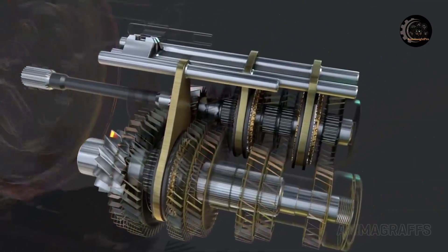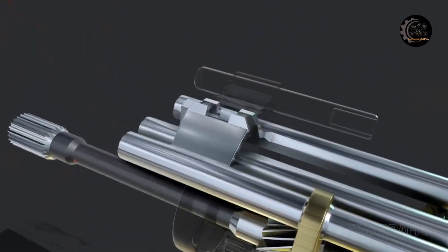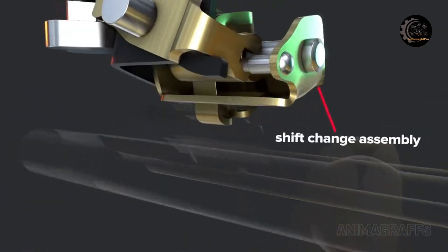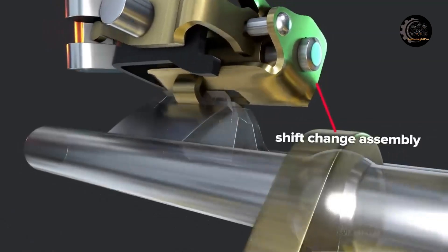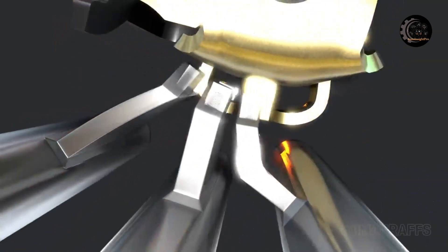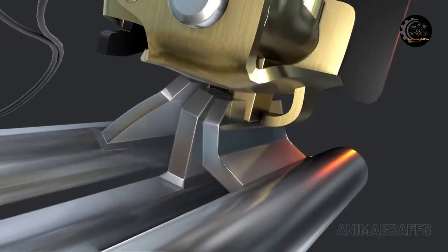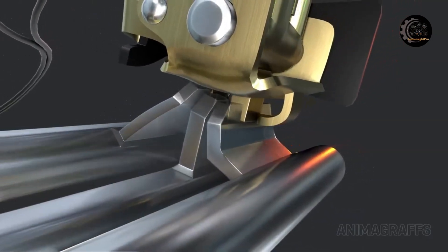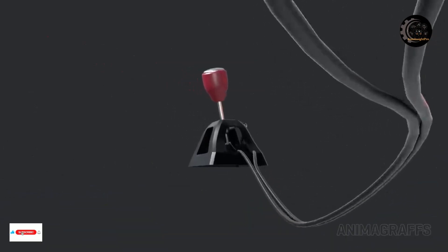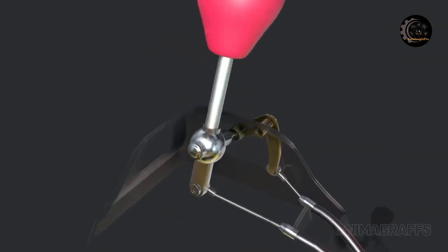The first and second floating gears operate from the output shaft, but this doesn't fundamentally change functionality in any way. Forks and rods only move back and forth as directed by the shift change assembly. This component can swing side to side to select a specific rod and fork, and once selected, a metal tab pushes the fork one way or the other.